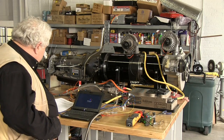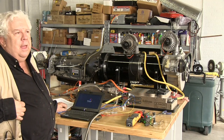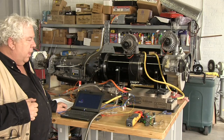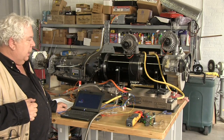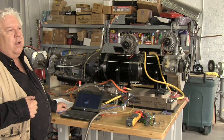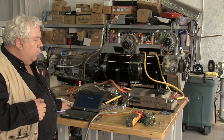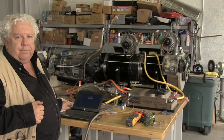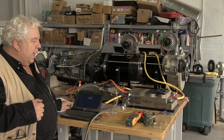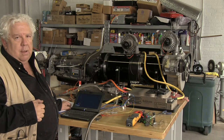The other thing I like very much about this, and they have changed it. Recall that I had told you all several times that there is one mistake that almost everyone makes in configuring their controllers, and I have no idea how many cars are out there working at half what they could be doing, with owners who are vaguely satisfied and have no idea what they're missing. And it's the most common mistake done with controllers, and that is to set a lower voltage limit value.